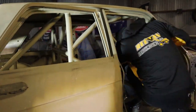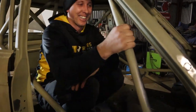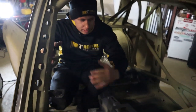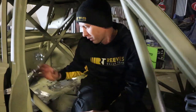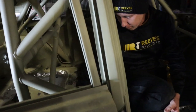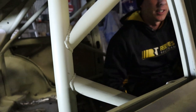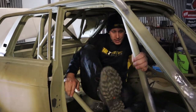This is where I'll be sitting, so I can't wait to drive it. We're going to be as far back as possible. This car is quite unique for the Datsun — we've put the roll cage right back on the rear seat mounts, so that allows me to sit back 100mm further, meaning the centre of weight should be better. We're really looking to get that rear traction, which the Datsun 1600 lacks a bit of, and we've worked pretty hard on that.